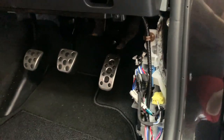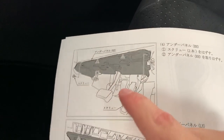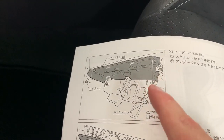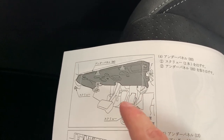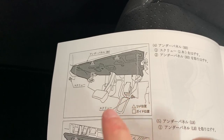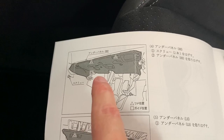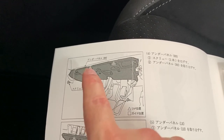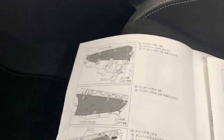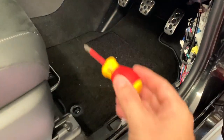Let's look at the next step. This is the panel just above the pedals. It's actually got two screws — one there and one there. I'm going to have to lie on the ground for this, I'll set up a towel. I've got my little stubby screwdriver. Here's the first one — just be gentle but apply decent force, you don't want to strip it. This just goes into plastic. I'm going to keep the screws in a little storage container — I'll put the little resin nuts in the center console for now.